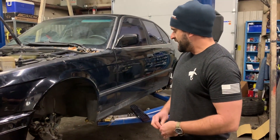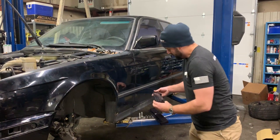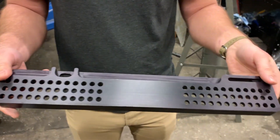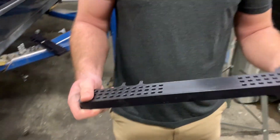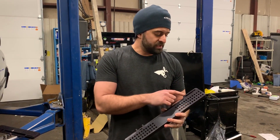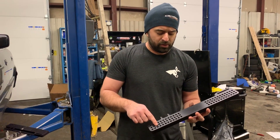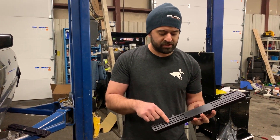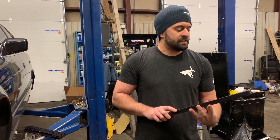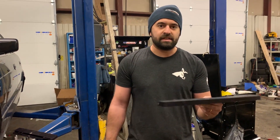The second thing we're adding is 60-61 aluminum floor mounts to adapt a race seat. The only thing tricky about these is that the E34 front seats use a hook and not a bolt. So it's a standard multi-hole aftermarket seat bracket so you can adjust sideways, forwards, anything like that — but these are designed for the E34 specifically, and they weigh almost nothing.